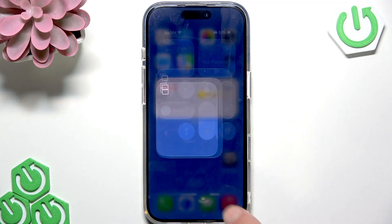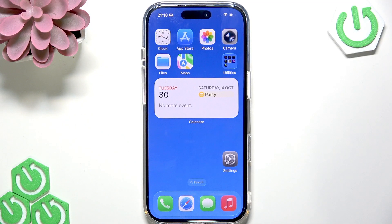If you want to screen mirror your iPhone using a wire, you have to connect a cable. Use a USB Type-C to HDMI adapter and a compatible HDMI cable, and plug them into your iPhone with the other side into your TV. Then switch the input on your TV to the correct HDMI port where the cable is inserted.